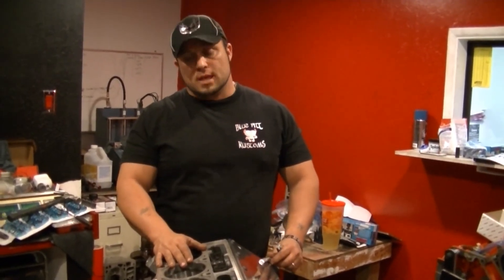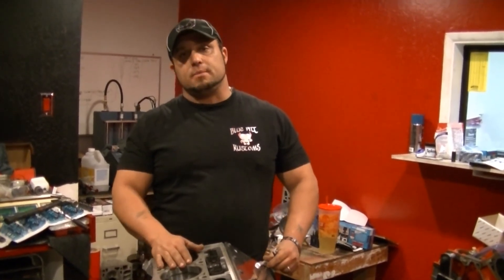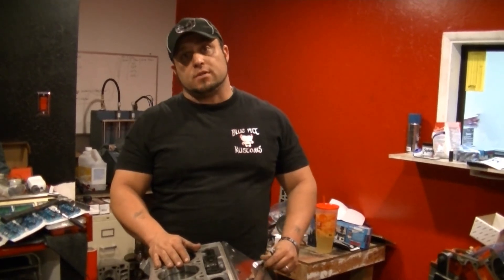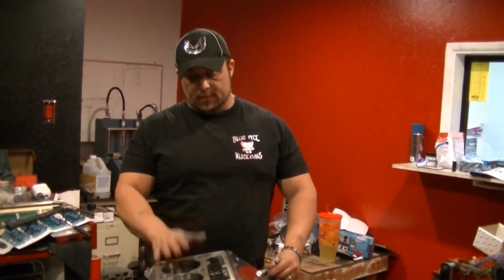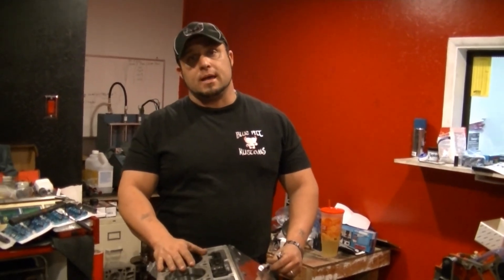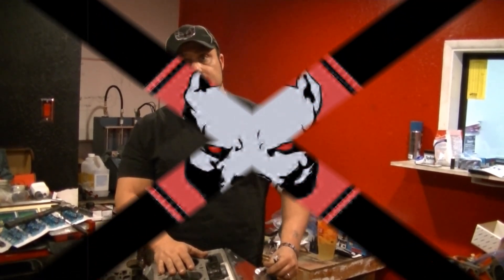And that's on low boost — that's like 10 pounds of boost. The ring gap on this: we talked to the manufacturer and he said that's safe up to 15 pounds. After 15 pounds, we have to call them back and go over everything again. Once again, thank you for stopping by and checking out Street Kills Video Chronicles — how to file fit your piston rings. Have a great day, guys.